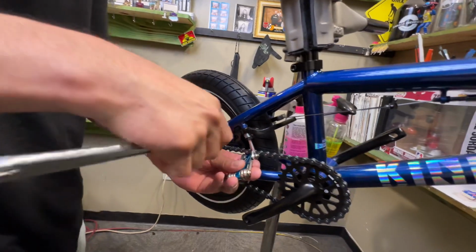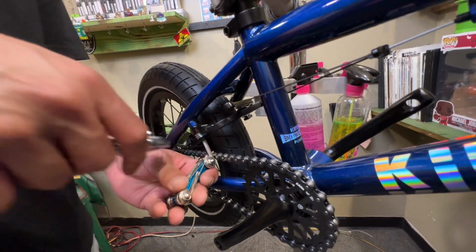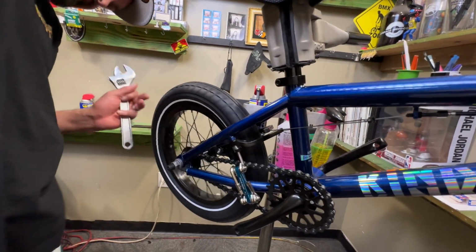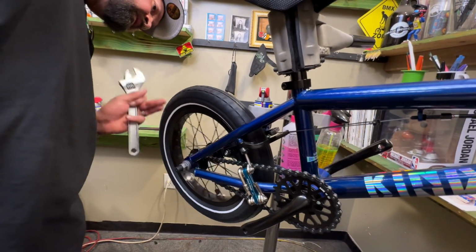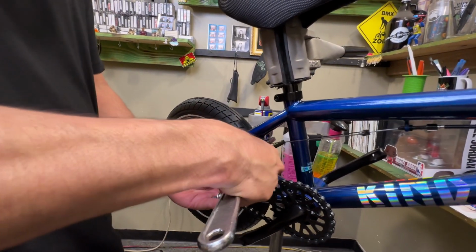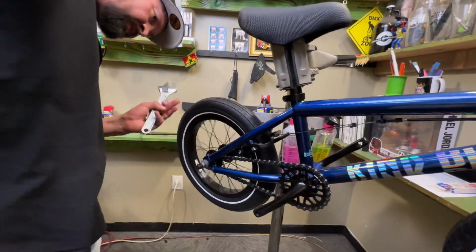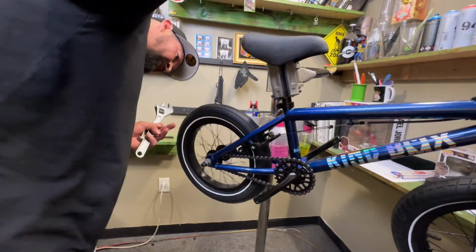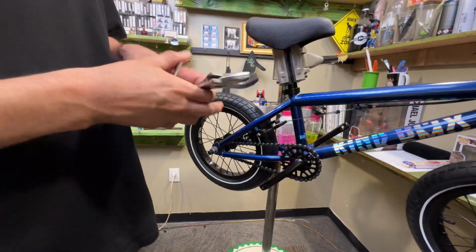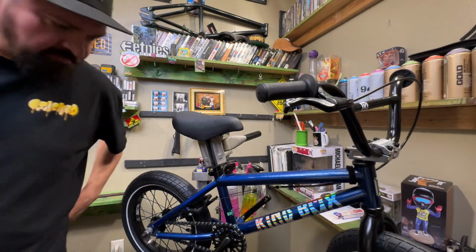And it moved the pad over a little bit, and the lever feels a little bit softer, like easier to pull. So that's a plus. Okay, a little bit more. I think it's just a hair more. Let's see this. I think right there should be good. Oh yeah. Yeah, now we got some space. The brake lever is easier to pull, and that'll help him stop more.